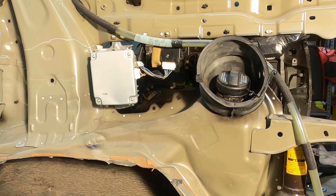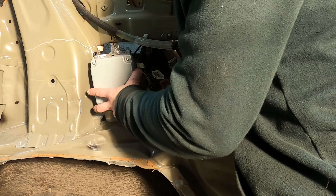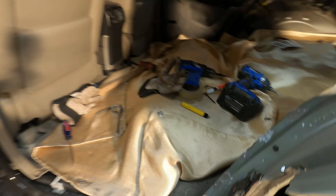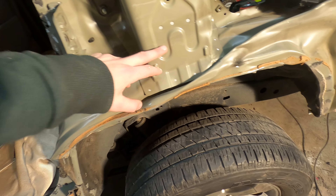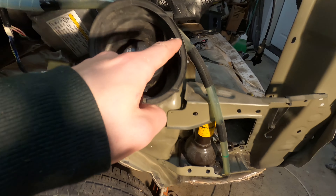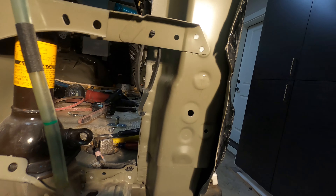I'm going to go ahead and start moving some of this stuff out of the way. So I started going around and placing some of the dots where the spot welds are that are holding this wheelhouse. That basically starts right here, goes right there, behind this piece, goes around here, goes down here. Then I also have to take those two spot welds off, and then these two.